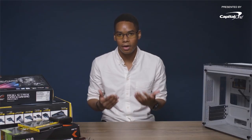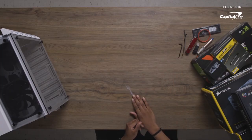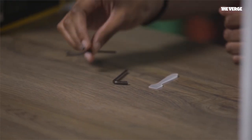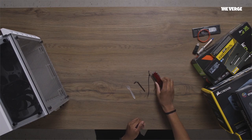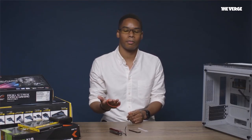What do you need to build a desktop? First you need a table — preferably not metal. If it's going to be metal, have an anti-static working surface layered on top of it, a thermal paste applicator, an Allen wrench, some zip ties to tighten up the wires, a Swiss Army knife which hopefully has a Phillips head screwdriver in it, and last but not least, an anti-static bracelet to protect you and the parts. You also need a regular Phillips screwdriver. An anti-static wristband requires you to be grounded — just having a band on your wrist adds no benefits, besides maybe a fashion statement.